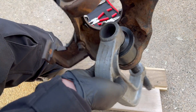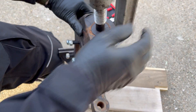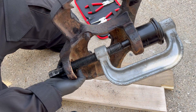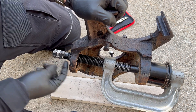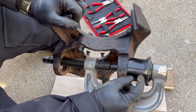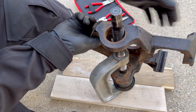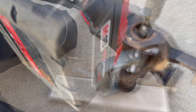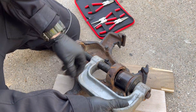Checking the underside — we still have travel for that ball joint to go upward, so even though it's taking its time, we are getting there. Now tackling the upper ball joint. The reason I like to take the bottom ball joint out first is so I can run the threaded portion of the press through the bottom — if I left the bottom one in, I wouldn't be able to do that. Same setup: sleeve, hat, opening through the bottom to let the ball joint travel upward. And there we go — easy peasy.